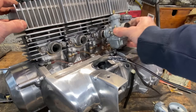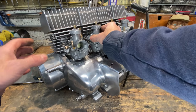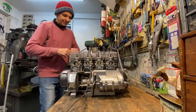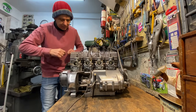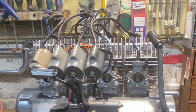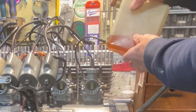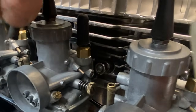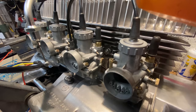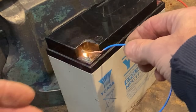With the four carburettors assembled, I put them onto the engine one at a time and they looked just amazing. I then fit the throttle cables and adjust the slides so they open together. With the throttle working nicely, the next thing I do is refit the coils and connect up all the wires, put the plug caps on and then fill the carburettors up with a little bottle of petrol. I just want to check that the engine fires on four cylinders before I take it somewhere remote to test it properly and rev it up. So with the carburettors full, I connect up the battery and give it a kick.